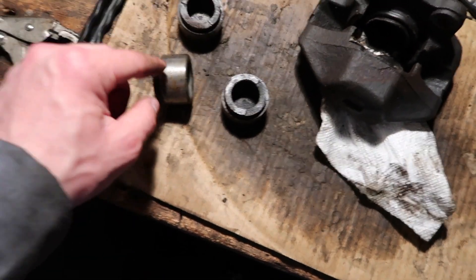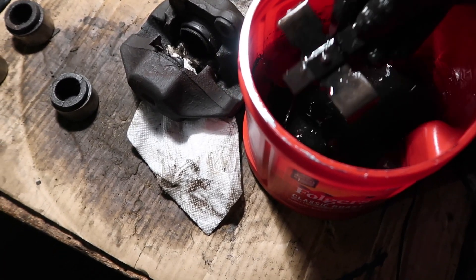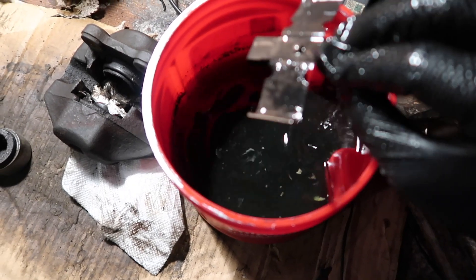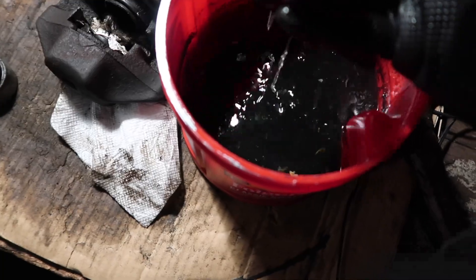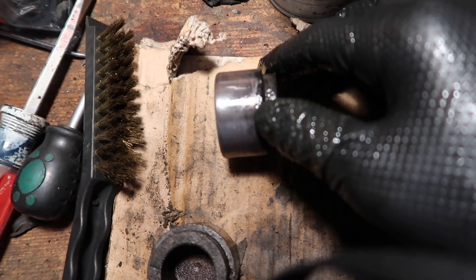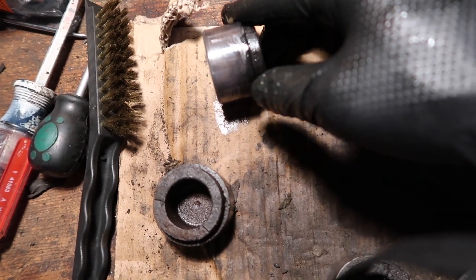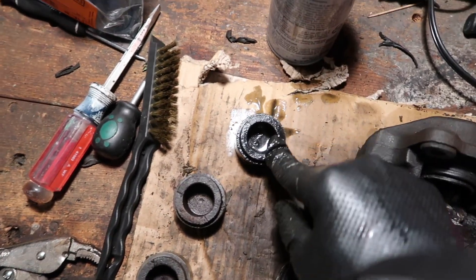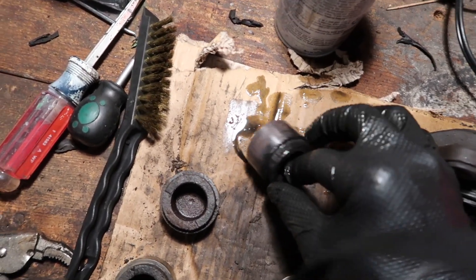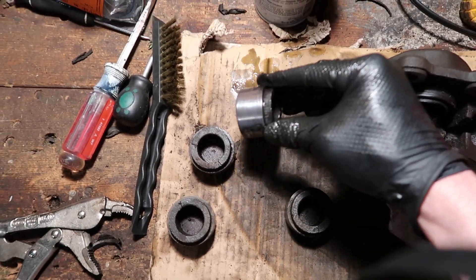The first one I got out, which I left in overnight, had worse pitting than the others. Here's my acid bath — there's the front rattle clip looking really nice. I'm going to find that rear piston — see that outer edge where it's kind of black, that's where the pitting took advantage of this piston, so it's still pretty pitted. It's only on the edge, which isn't bad, you can maybe get away with it. I might have to ask one of the E28 or E12 heads who know more than me about this — I've never rebuilt calipers before, so I don't want to risk it and have them leak.